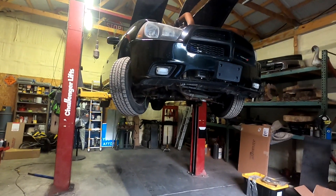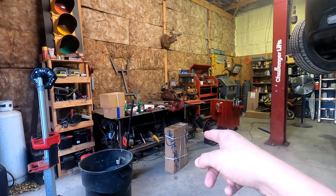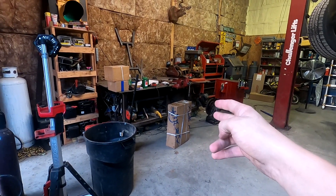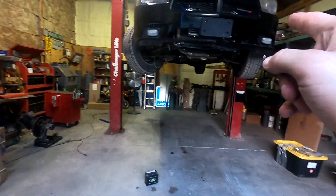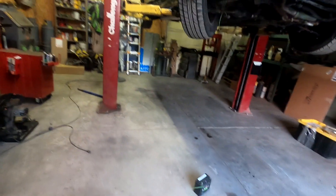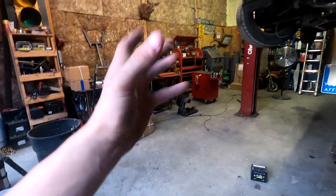We probably have about 700 to 1,000 pounds extra up front — I think 1,000 is overkill, probably closer to 700-800. Those right off the bat are 400 pounds more — well, the spring rate is 600 pounds per coilover, so two of them should support about 400-500 pounds over the factory shocks. Since they're adjustable, we'll turn them up an inch. That should give us another inch of lift — an inch lifts 600 pounds, do that twice, 1,200 pounds. We'll adjust them half an inch to an inch, put them on, and see what it looks like.